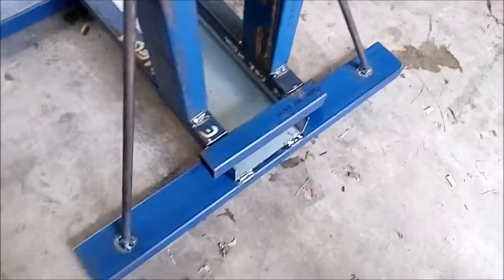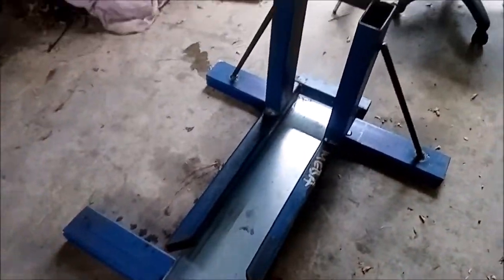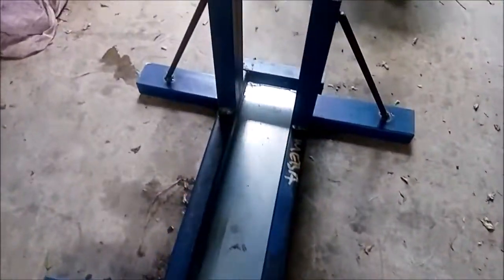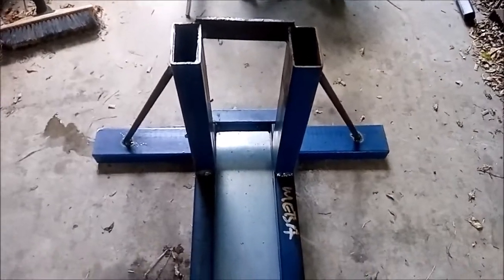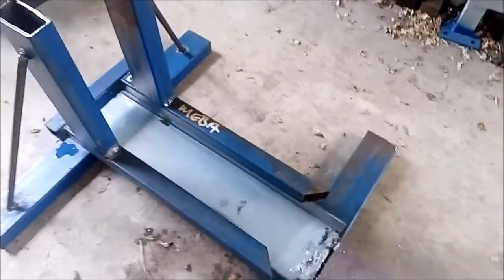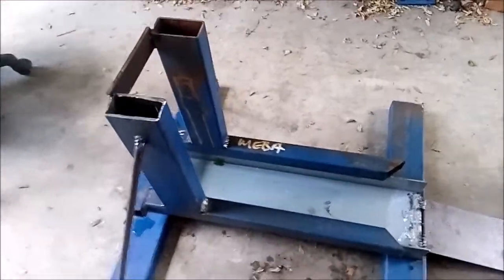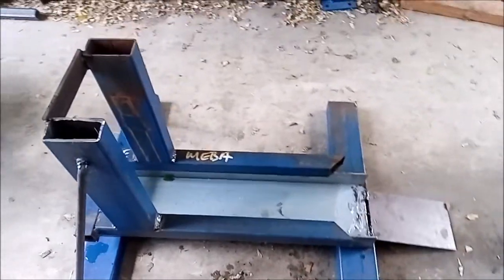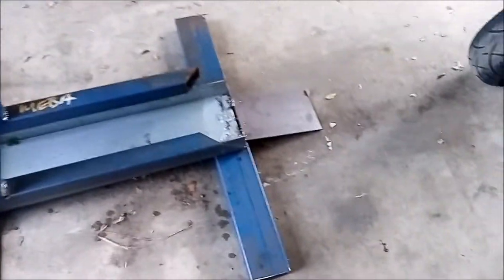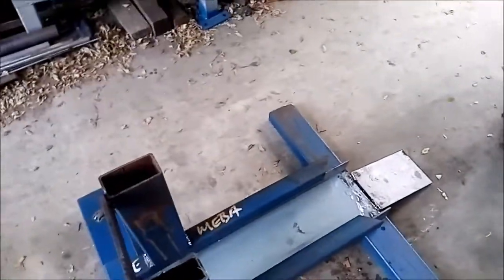If there's any other dimensions anyone might need or any advice about making one of these, feel free to leave a comment. The main thing is to get a nice snug fit against your tyre through there — you've got to make that part fairly accurate — and the bike will just stand up in there by itself, not going anywhere. You can also put a couple of straps on there if you wish, or just put the bike in gear, and be mindful that if you're jacking up the back wheel it won't be in gear any longer. Anyway, that's it — safe riding everyone, catch you in the next one.